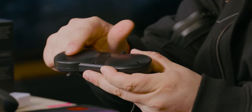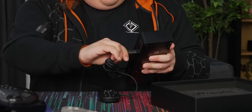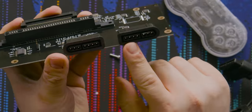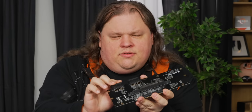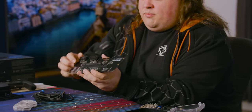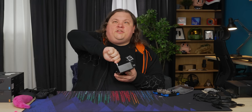This is the Super Nintendo module. It's got bulb-like shapes on the back here and has the original controller connector. It doesn't feel like these are very well anchored — do you want to get me an iFixit kit real quick? The reason I took it apart — you can actually see the ICs and the cartridge slot and everything — was I wanted to look at these ports. Apparently they're just on there with rather robust posts, which is similar to how it was on the original hardware. But the original hardware also had plastic housings kind of clamping it in, so you were distributing that force a little bit more. You know you've done a good job when you always have a leftover screw.